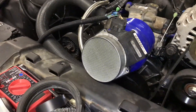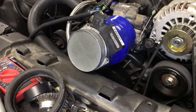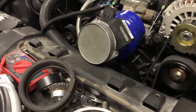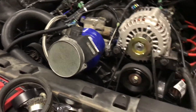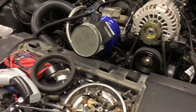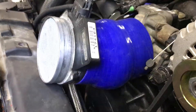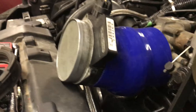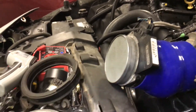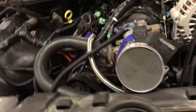I got this bellow for the MAF sensor. This MAF sensor is off a Northstar V8 and it's actually the same part number as the Silverados. I believe this came from a 2003 or 2004 Cadillac. They were having a u-pull-a-thon at our local u-pull — an hour and a half away — and I was walking down an aisle and noticed it looked just like one of the truck ones. I ran the part number and sure enough it's the same as a Silverado. I picked it up for $17 and it fits perfectly in the LS-style bellow, even with the little inserts on the sides.